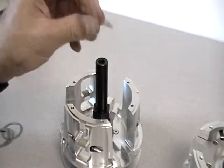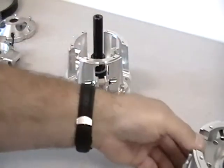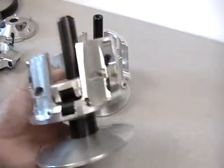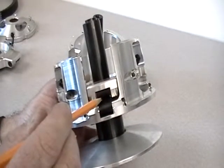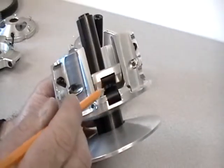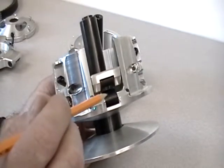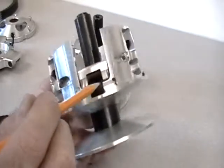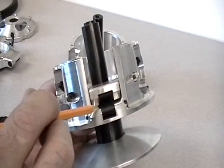The large washers — these are the spider washers. What those do is create a gap between the roller and the second stage cam arm. If I want to space this farther apart, that lowers my engagement and makes the cam arm hit harder when it first takes off. If I want less spider shim, that increases my engagement and causes the cam arm not to hit as hard at initial engagement.